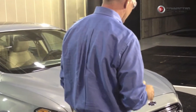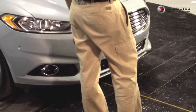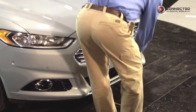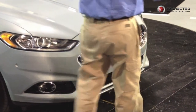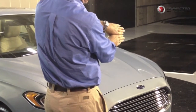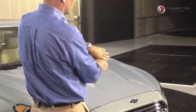We've got a lot of features on this car. First of all, underneath the car, we've smoothed out the bottom to get the air to go under there very nicely — that was a big help. We also have what are called active grille shutters. They're inside in front of the radiator. Basically, they're like window blinds that open and close. They close when we want good aero — we don't want air going through there. They open when we need to cool the vehicle. So going down the highway, they're going to close.